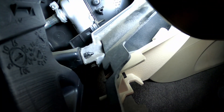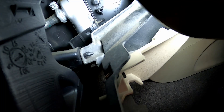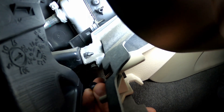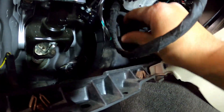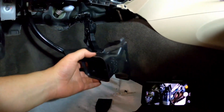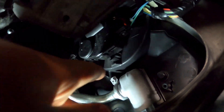There's the part. This part's kind of cool — there's this little pin that shoots up in between those little plastic bits. Just get a little screwdriver in there and push that pin back out. With that pin missing, the two edges of that little beak can push together and pull right through — easy. Just get your fingers underneath that little tab there and it clips right out. Now we have full access to the motor. That's the actuator motor on top, and there you can just see dangling below is our broken piece.